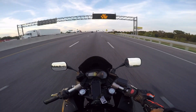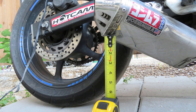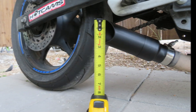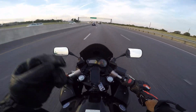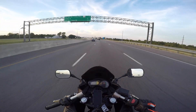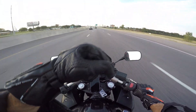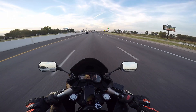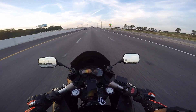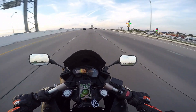To give you an idea of the ground clearance difference, check out these two pictures — I went ahead and put a tape measure up there for before and after. The overall height of the openings is almost identical, but it's the profile of the shorty GP versus the Yoshi that's the big difference. The Yoshi is that trapezoid, triangular shape and that outside angle is what contacts the ground. This shorty GP is nowhere near contacting the ground, so it's going to serve its purpose. How long it stays on the bike is yet to be determined, but at least for track days, this is what we're going with.